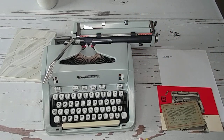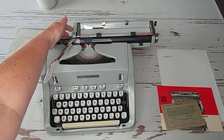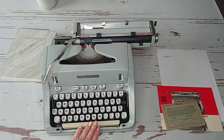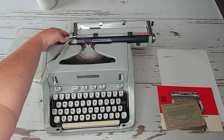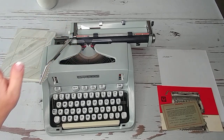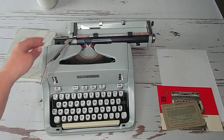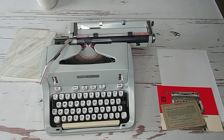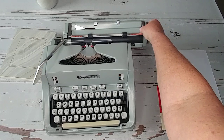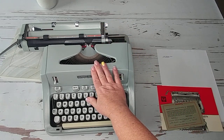Same with the right side — your carriage release on the left side is this white little button. You have the same metal tab; put your carriage where you want the left margin to be, pull it in, and the little red area moves. That's how you set the margins. If you're like me, you may keep accidentally setting the margins when you're trying to move the carriage, because the buttons on the side are your carriage release.